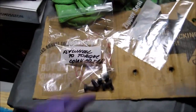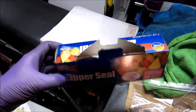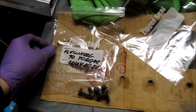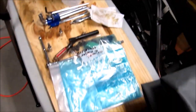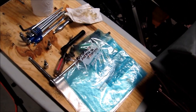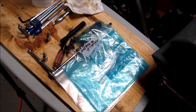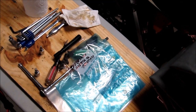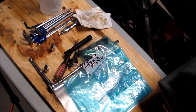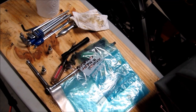I got the six bolts out. I suggest you buy a box of Ziploc bags — right where the bolts come from — and put them in the bag so later on you won't have any questions where the bolts are coming from. Also, if you're going to have a tough time turning the engine to take those six bolts because they go all around, you might want to pull the spark plugs out because the compression has some resistance. If you pull the spark plugs, there's no compression and the crankshaft will be much easier to spin.